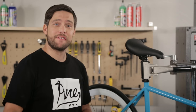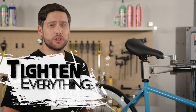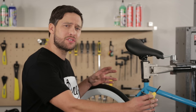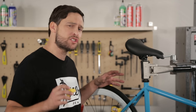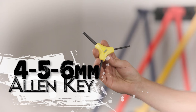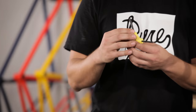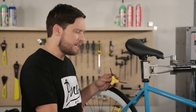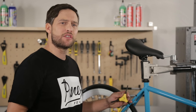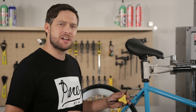Next up, tighten everything. Road vibrations can loosen the bolts on your bike over time. You should check all your nuts and bolts within the first 30 days of riding and it should be part of your regular maintenance. You'll need an allen key to complete this task. You're going to need a couple different sizes because there's many different bolts on your bike. Check your seat post, your saddle, your headset, your brake caliper. Just don't over tighten them. Everything needs to be snug and this is something you should do every year.